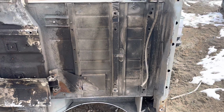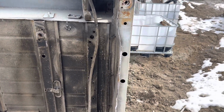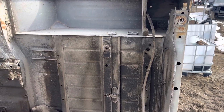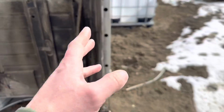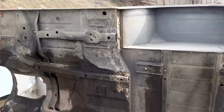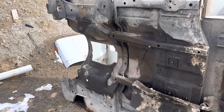This is actually for a customer that's looking at doing the rear torque pocket, either building something or we cut this one out and sell them this one. The rear torque pocket. So first off, let me go over real quickly how many bolts through frame to tub you're going to have on a given body. Okay, so you've got 2 in the rear, 1, 2. These are your rear corners to your frame. You have 2 above your fuel tank, so you can't see those. And then you have 1, 2, 3. So you have 6 here and 4 back here, for a total of 10 on the tub, and you have 1 at the front for your radiator support, otherwise known as your grill.